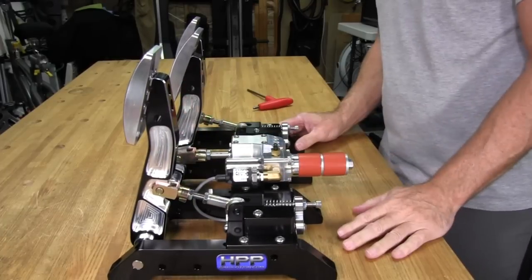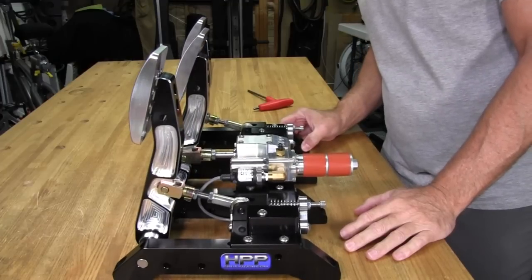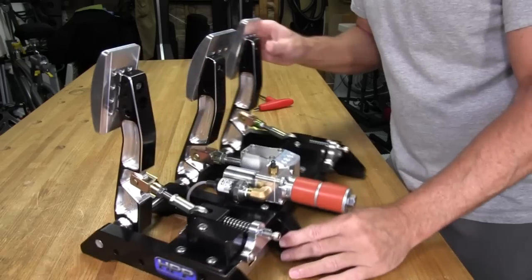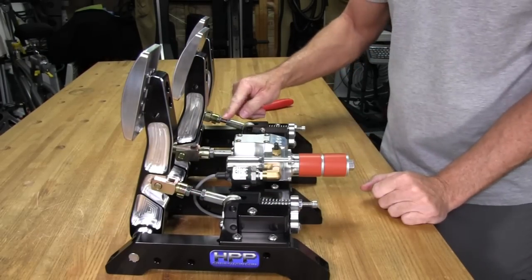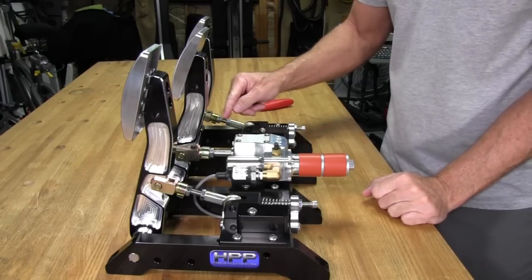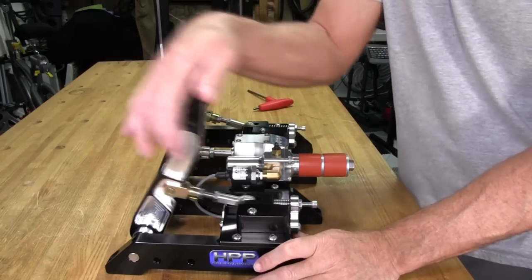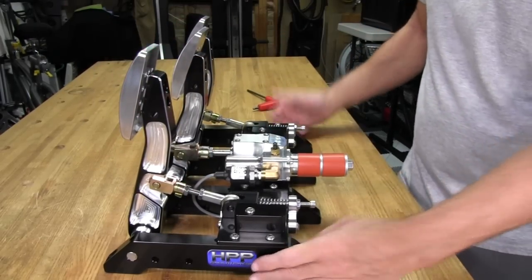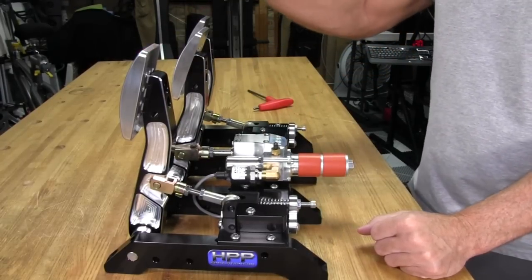And you can see our angle is really laid back now. Of course, you can see my throttle pedal is actually a little bit forward of everything else, but that's easily adjustable right here. And actually, if I look at my clutch over here, I can see that there's a lot less thread available or exposed here than there is here. So I would just pull this back, or maybe I wouldn't pull it back, depending on what I wanted it to be. If I wanted to, maybe I want the throttle pedal up that high. But the beauty of all this is I can actually independently adjust this guy and this guy.